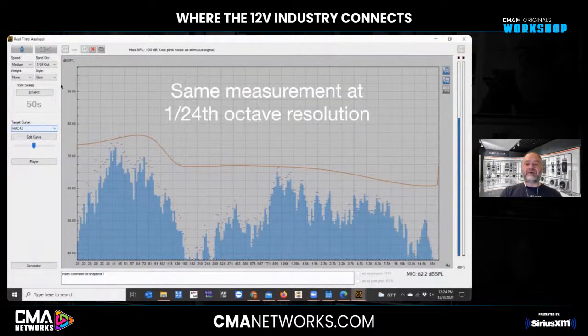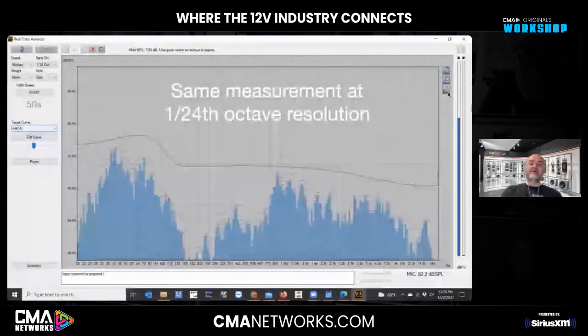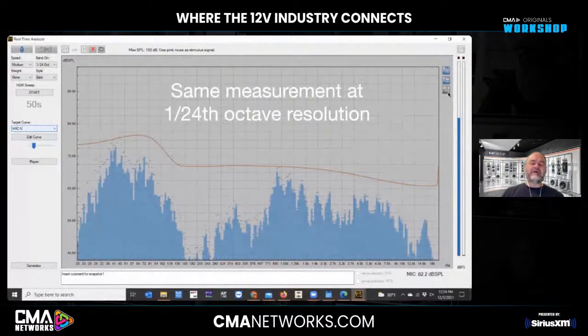One thing I will mention also is that we have the ability to save measurements and then load them in the background, so we can actually tune the right side, save it, load it, and then make the left side match. When I say make the left side match, it's because a lot of times our systems are not perfect. They have some imperfections, and we want those imperfections to be identical, or roughly similar, left and right when we're working on our stereo imaging.